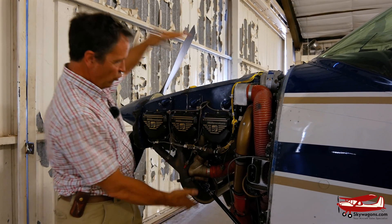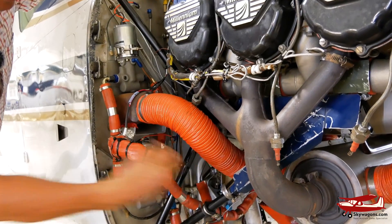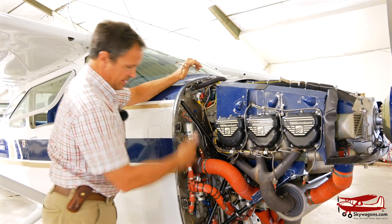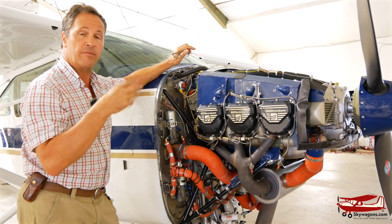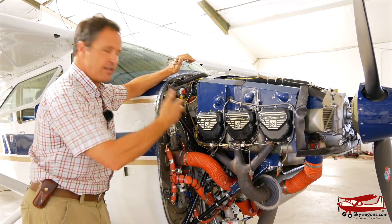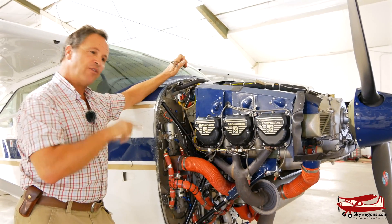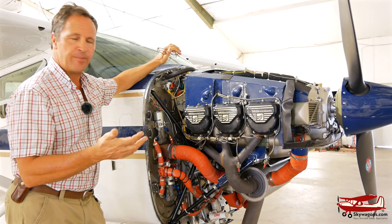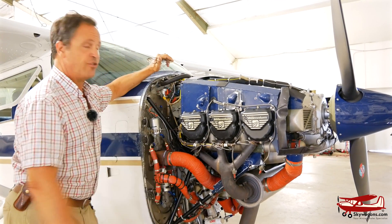There are two independent continual-demand fuel pumps on the right side of the engine firewall, with a fuel line to the carburetor. Each one could run continually, but there are two for redundancy. If you're at high altitude with high manifold pressure in cruise and turn off the pumps, it'll quit — just like turning the fuel selector off. There is a manifold pressure setting for every altitude where the pump wouldn't be needed, so you can taxi on the ground without them, but always use the pumps in flight. Redundancy.